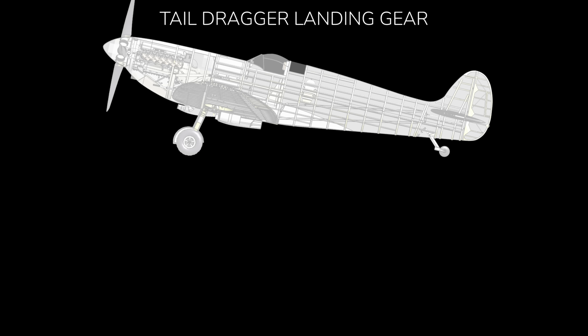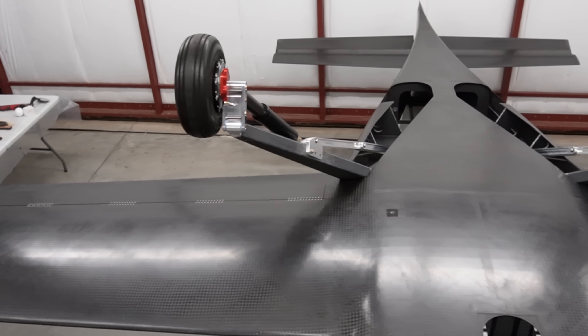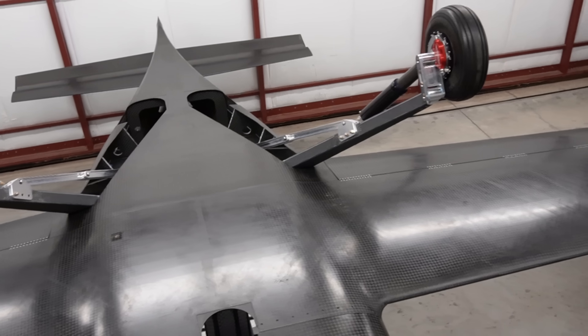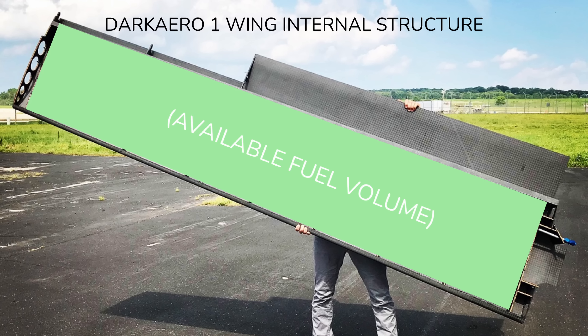How the landing gear is mounted to the airframe is important. The two most common arrangements are either a tail dragger configuration with two main wheels up front and one small wheel in back, or a tricycle configuration with one wheel up front and two main gear positioned behind the forward wheel. The main gear can either be mounted on the fuselage or the wing. Mounting the main gear to the fuselage, as opposed to the wing, helps keep the wing aerodynamically clean and avoids additional structure in the wing, which helps free up more space for fuel allowing for more range.